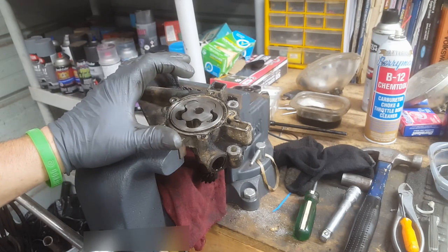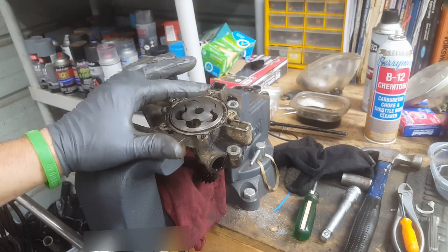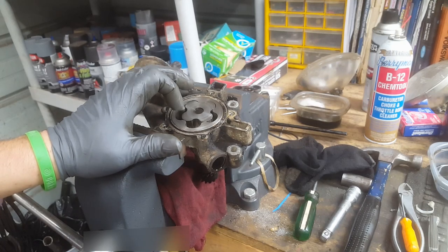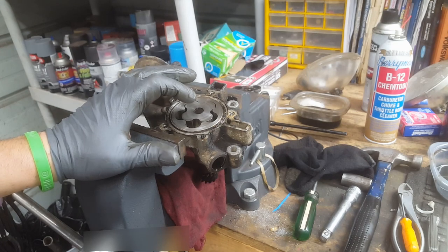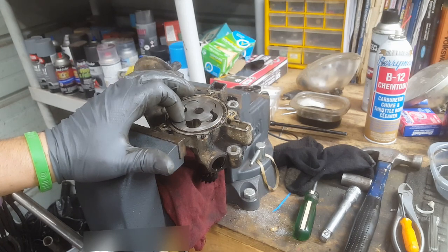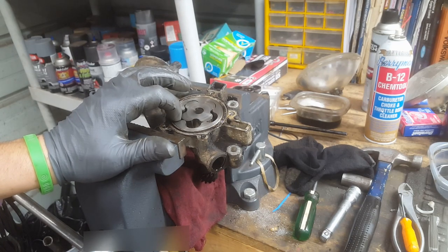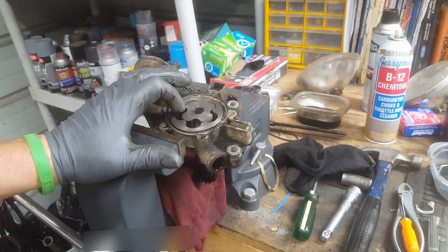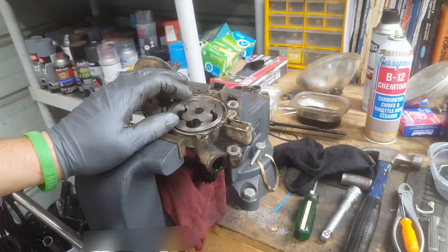But without being an oil pump authority, my backyard mechanic know-how tells me this, let me put it in layman's terms, so any of you guys or ladies that don't know anything about oil pumps will know. This inner rotor spins and this outer rotor is capable of moving, but essentially it squishes the oil; it pulls the oil in out of the oil pan.